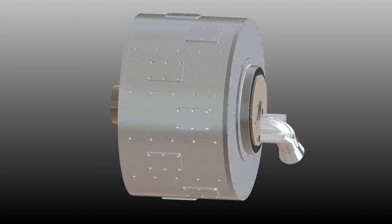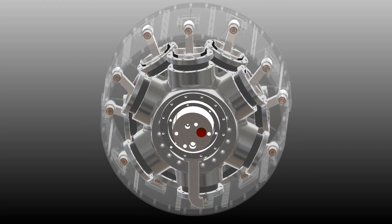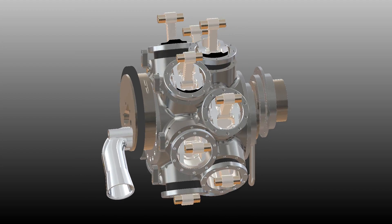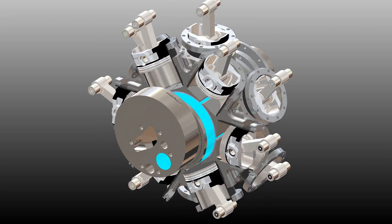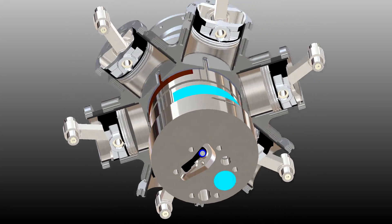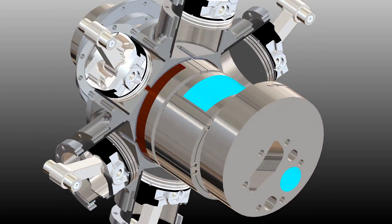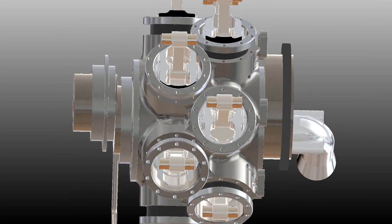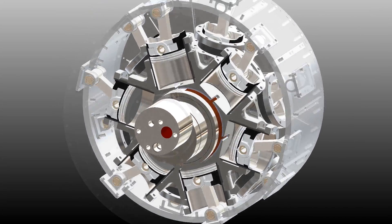The Doyle Rotary is a split cycle rotary engine that utilizes two rows of pistons and cylinders. Each row of cylinders performs one half of the four-stroke cycle. The first row pulls in and compresses fresh air, while the second row completes the power and exhaust strokes. The combustion cycle is completed six times per revolution. As the cylinder block and outer housing rotate, displacement occurs without any reciprocating mass.